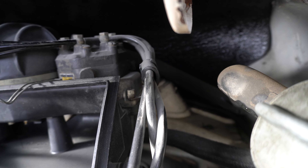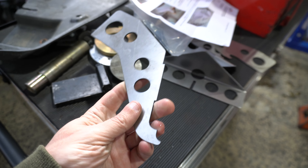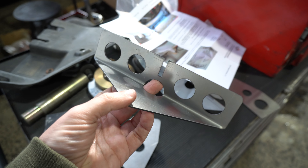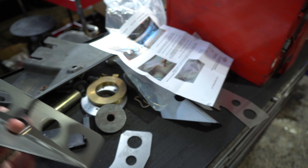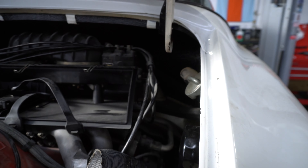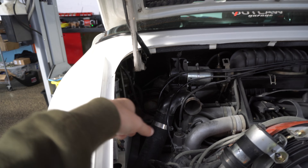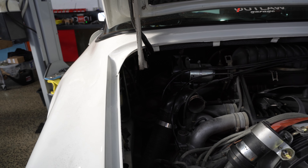So we're going to be dropping the engine. We are going to change the engine mounts — there are two on the gearbox as well. What we're going to be doing is putting some reinforcement on the suspension struts. This is from Elephant Racing — we'll explain about why we're doing that later. Ordered on Thursday, turned up in Australia on Monday with FedEx — shipping absolutely fantastic. We'll drop the engine to put them in. I thought we could do it with only a 10% engine drop, but the engine bay is a bit more awkward on an SC. So the guys are going to drop the engine, scrub it all back, weld them in, and then it'll look like it should from the factory.